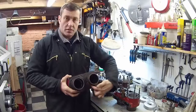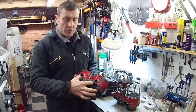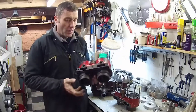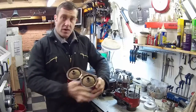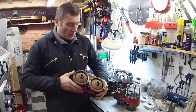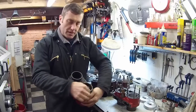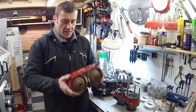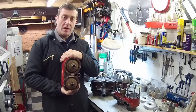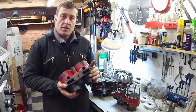We have the inlet ports around the centre, the transfer ports on the back of the engine, and the exhaust ports on the front. Some of them also have decompressor holes in the front of the block. We have the water jacket around the cylinders, then various different finishes for the top. This is the water pipe. This is a 500cc — we can tell that by the wall thickness — this is a 500cc short stroke blind head block, fitted on pretty much all the bikes through the 20s into the early 30s.